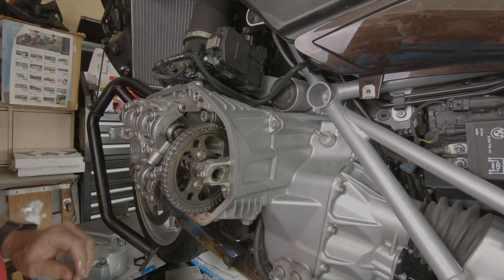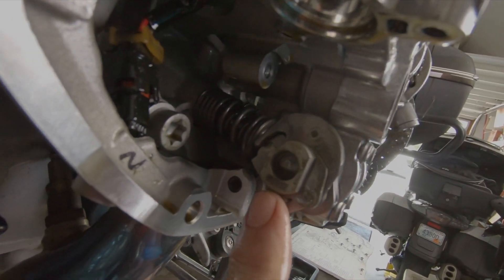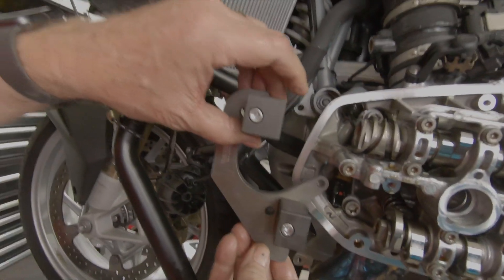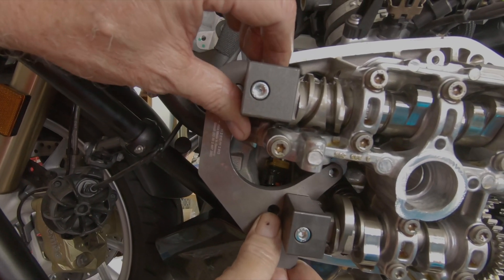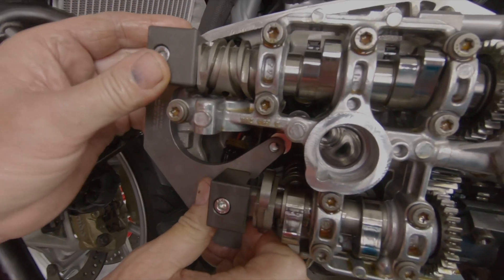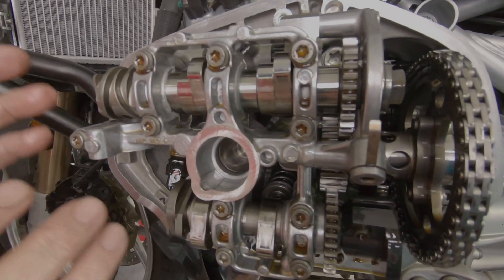You can remove the engine turning tool now. Looking here, the three square sides of the intake cam are up and the laser-etched mark is at the bottom. On the exhaust cam, the laser-etched mark is also at the bottom. I have the cam alignment jig — it goes flat against the face of the casting, and you slide it in. It should lock onto the ends of both camshafts simultaneously, but it doesn't lock onto either one — it's just standing out and won't engage the flats.